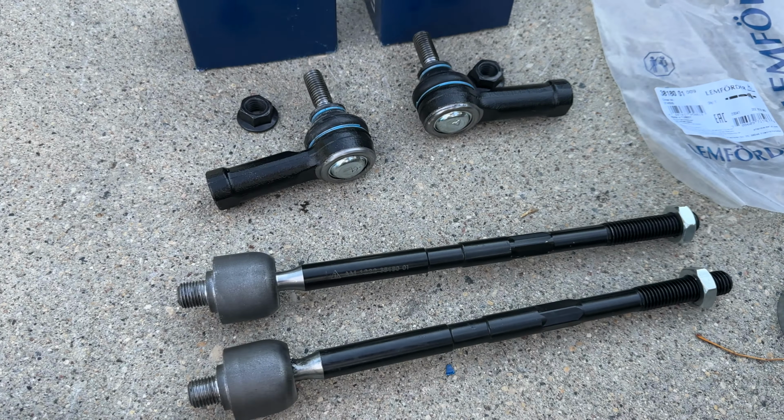Next, just a regular automatic transmission fluid. I had this bottle laying around for quite a while, so we're gonna fill it to the top, and the return hose will go into some kind of container, and I'm gonna turn the steering left and right until I'm gonna see nice fresh fluid in the return line. And I need to add fluid as it's being spilled out. That's the procedure to flush the system.